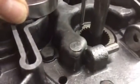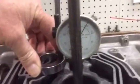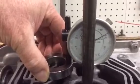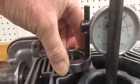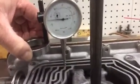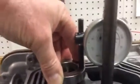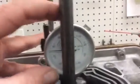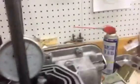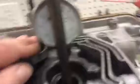That's the mating surface where the diff bolts up. You set the tool down in there and get the point down on that hub and take a reading. The book says not to go more than 50 thousandths of throw — we're at about 30 thousandths. To keep the math easy, try to make it so it only goes maybe 40 or 50 thousandths. Now that we've got that on there, we're going to zero our gauge out. I had to use both hands — now my dial indicator is at zero. I'm on the plane of the mating surface, and my dial indicator rod is on the hub.